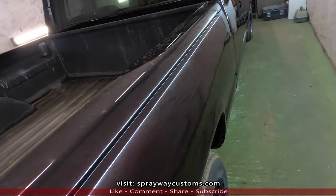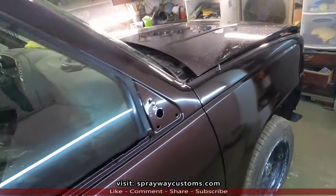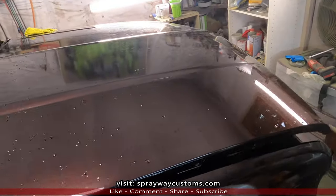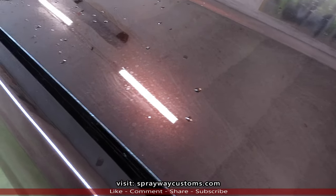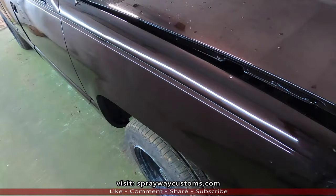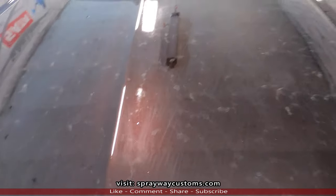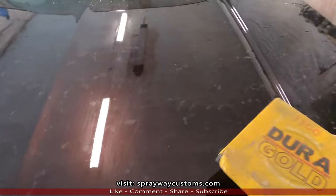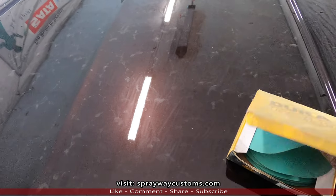Got the truck in here. Still got a little water up here on the hood, but it don't matter because I'm going to wet sand it anyway, so ain't going to be no problem. I'm going to be hand blocking — I'm going to use some 1500 grit. This here is for the DA, but I'm just going to take a sheet and wrap it around my block.